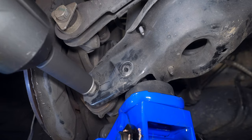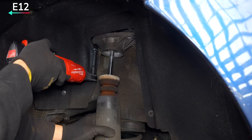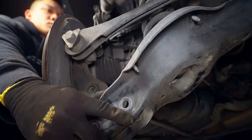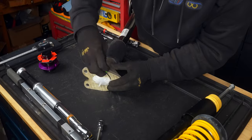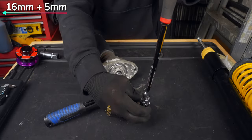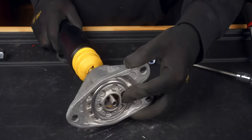So if you don't have that specialty tool, you could do the rears yourself and save on the install costs. But don't worry, we'll also go over how to safely install the fronts without a spring compressor. Sticking to the rears, you can see that if we were to do just lowering springs, we would need to do about 80% of the work, the difference being exchanging the strut. Another thing to consider is that with lowering springs, most of them aren't adjustable, and the ones that are, are about two thirds of the price of the V1s, or about the same price if you compare it to ST or BC Racing.